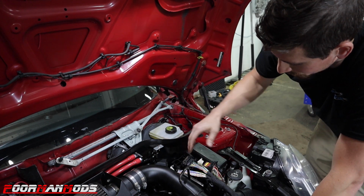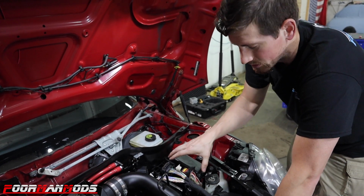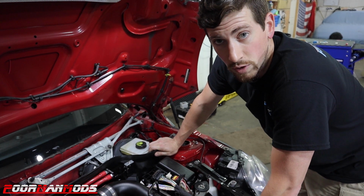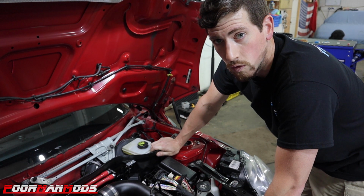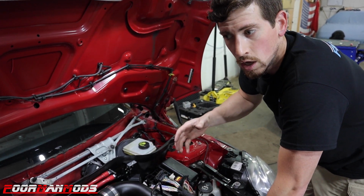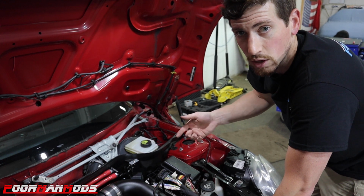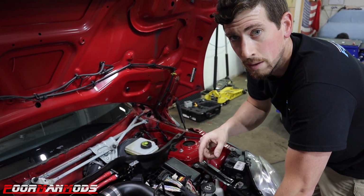And then all the wires are gonna come up here to the main ECU where we're going to make all of our taps. Now the biggest difference in what we're doing and the way we're wiring this up is typically, and the way Freddy did it originally, you would run the wires to the individual sensor or circuit depending on where they are. So with this install we're going to be tapping the ignition circuit, the clutch circuit, the accelerator pedal, and we need the crank position sensor for the RPM signal.